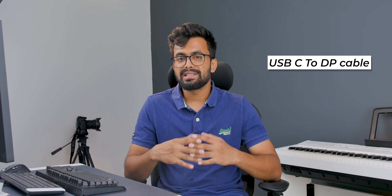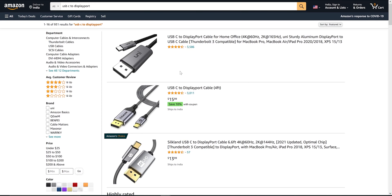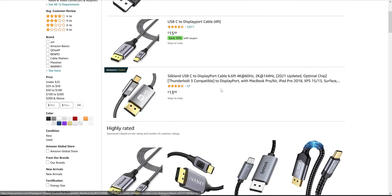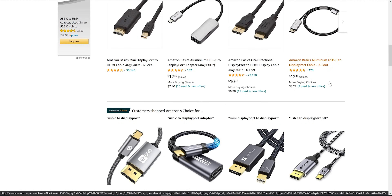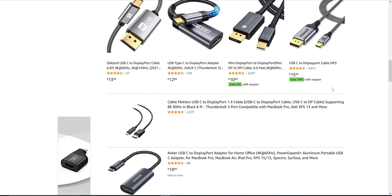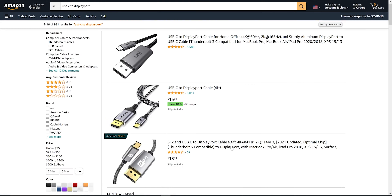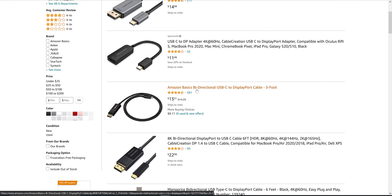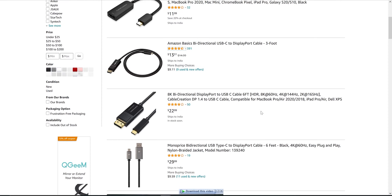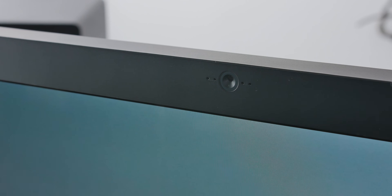For the next option, you can get a USB-C to DisplayPort cable, or a DisplayPort female to USB-C male adapter or dongle. Keep in mind that you cannot just buy any cable or adapter and expect it to work. Most of these cables and adapters are only designed to connect a laptop with USB-C to a monitor that has DisplayPort on the back, but you cannot send the signal the other way — these dongles are only capable of sending signals in one direction. So we need to buy a bi-directional cable or dongle. However, this is not a perfect solution as you won't get resolution above 4K and some other monitor features won't work.